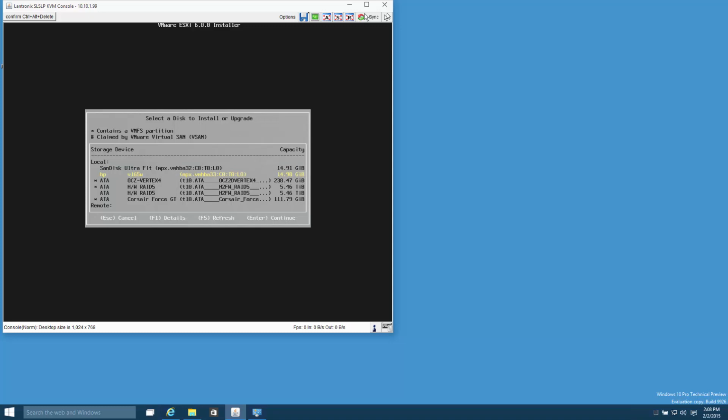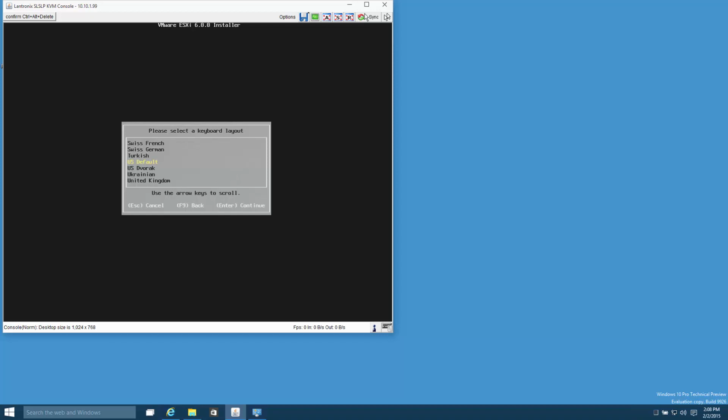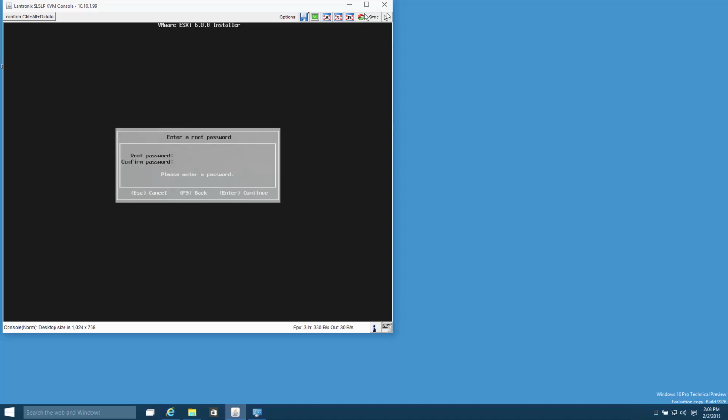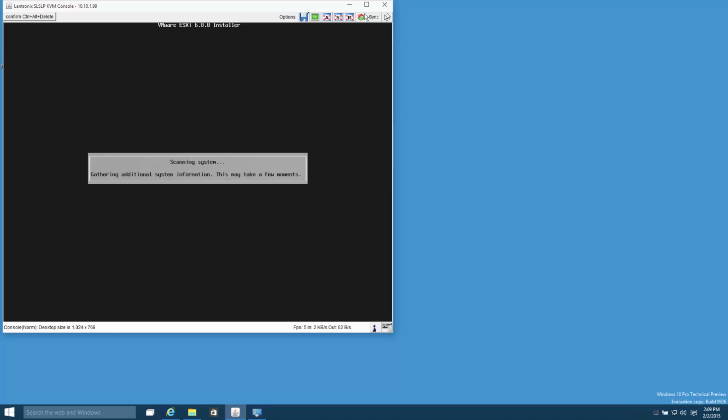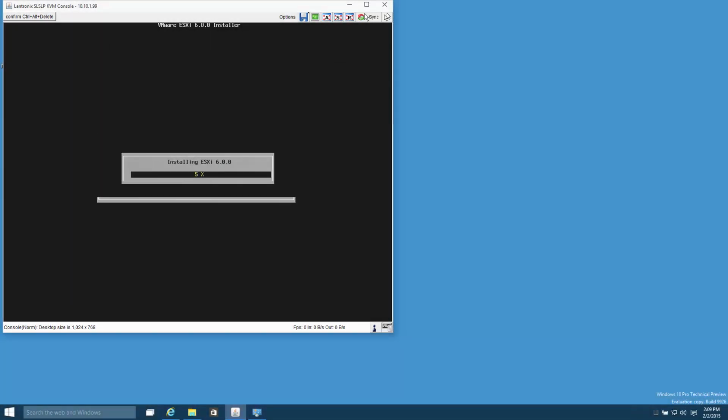So in general, you're going to find in yellow the media you're going to be trying to install to, right? So usually you don't have to hit up and down arrow at all, but you do want to confirm that whatever brand you bought, in my case, this particular video is using an HP 165, a 16 gig flash drive, you want to make sure that's what you choose from this list. So I'm hitting F11 to confirm, and off it goes.